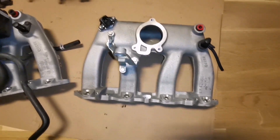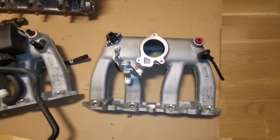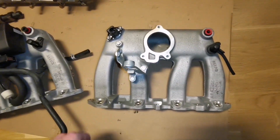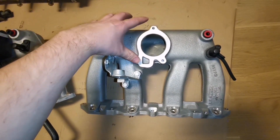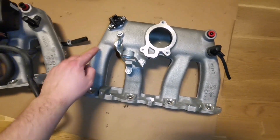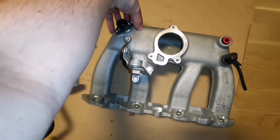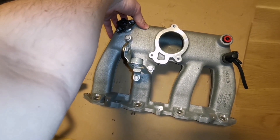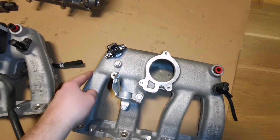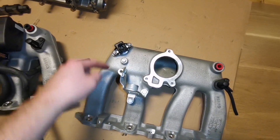There's no purpose to widening the port — there are some specific other things you can do. Let's talk about the general design of the intake manifold and why it's designed this way. We have air coming in straight into the middle, creating a tumbling effect and a high-pressure zone, and there's an angle on the runners going in towards the back end of the high-pressure zone here and here.